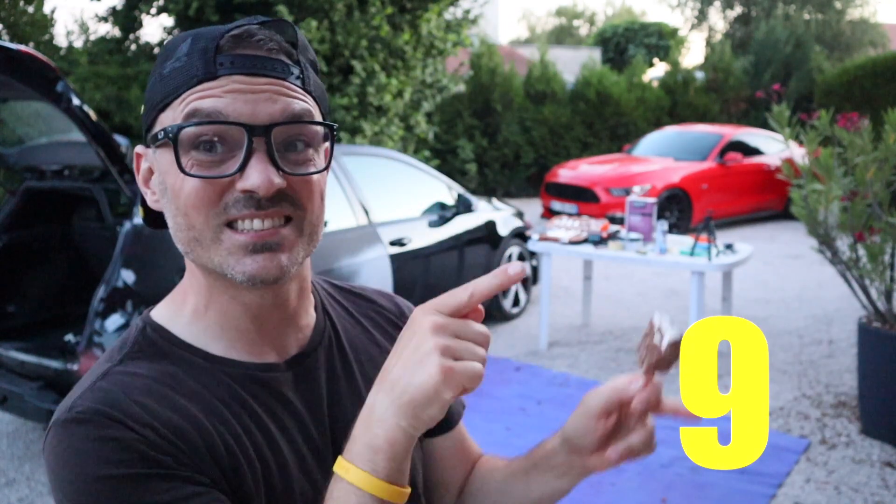So what's going on then? It's only just now cooled down to 26 degrees — this afternoon it was like 33 or 34 degrees, which in Fahrenheit means you need an ice cream. But as soon as I try and put any filler on that burning hot black paint bodywork, it's just not going to work. So I figured — because it's going to be mega hot all week — Wimpy Brothers will go twilight. We're doing an all-nighter! Basically what I want to get done tonight is get anything tidied up, filled, sanded flat, primed — ready for paint prep, ready for putting down the colour.